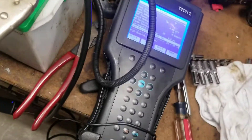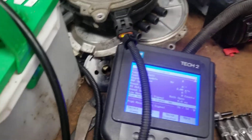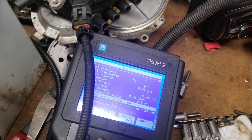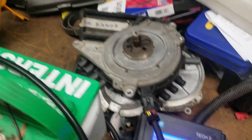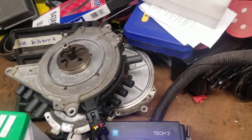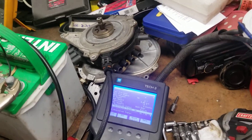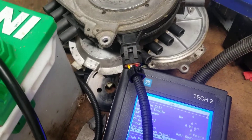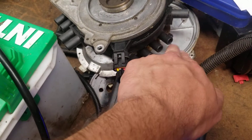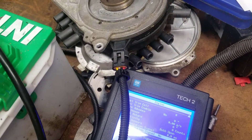This is a quick way of determining if the optical sensor is good or not — you will lose one of those signals if it isn't. I just tried all these different OptiSparks I have laying around, a whole box of them, and they all appear to have good sensors, so that's a good thing.